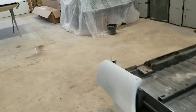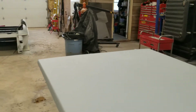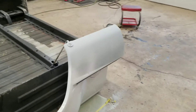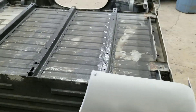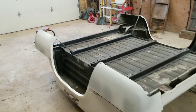Our primer's on, good and dry. I'm going to give it a good sanding — sand this top here with some 500 to make it go quicker, then go back over it with 800 wet and it'll be ready for spray. It laid out real nice. These spots over here I'm just going to use 800 wet on. They all turned out real nice and slick. I'll throw some 800 on a soft block and block them out to make sure they're good and straight — they didn't even really have any pinholes; they laid out nice and flat. Then I'll mask it up to blend these corners in since we're not painting the whole bed.